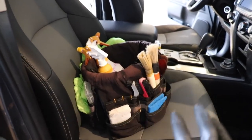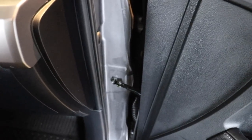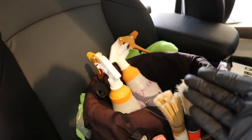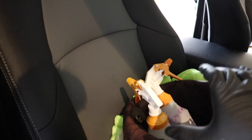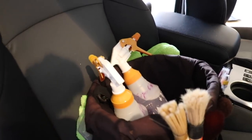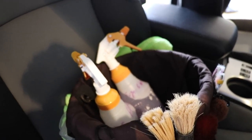I've got my bucket caddy right here with all of my interior detailing stuff, and we're going to focus on this door jamb. I can't really get the lighting perfect so you can see the inner workings of the door jamb, but even right here there are just no large amounts of dust, dirt, or anything. At most, I'm just knocking some dust around. I have the option to use a less intense or more intense cleaner. I am going to be using Super Clean diluted 5 to 1, which is a degreaser. However, I probably could also use Meguiar's all-purpose cleaner diluted 10 to 1 and get the same results because it's really not that dirty.